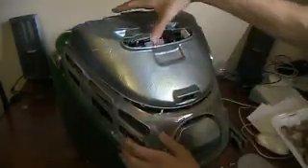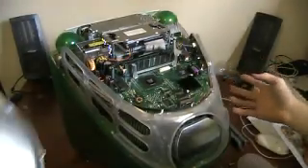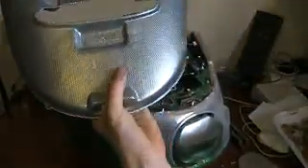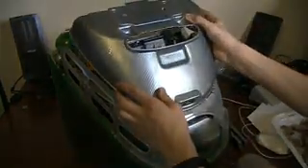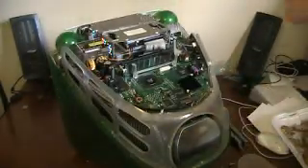Once you get here, you're going to have to take off this metal piece that covers your logic board. As you can see, there are screw slots right here. So depending on how many slots or how many screws you have, you just take them off. Then you take off the front like that and slide it out, because the monitor port is wedged into the hole — so you can't just take it off straight.